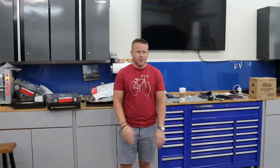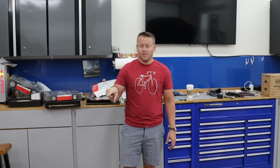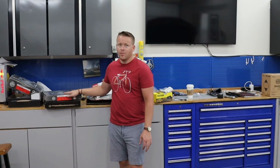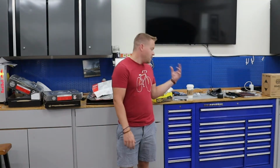So on this week's episode, I'm going to be doing the brakes on our Porsche Cayenne 958. I guess ours is a 6-speed manual, it doesn't really matter, the brakes are the same. There was some model year where they changed from 355 millimeter rotors to 360, so just pay attention to that. But just doing everything with OE replacement stuff, I got some Zimmerman brake rotors and some Textar brake pads, just OE replacements, nothing fancy. Also got all new hardware, all new wear sensors.